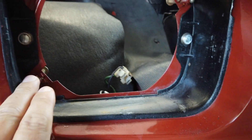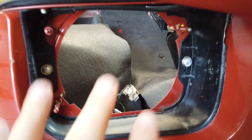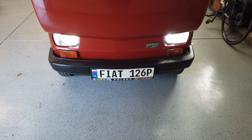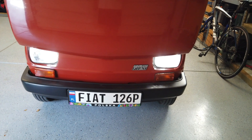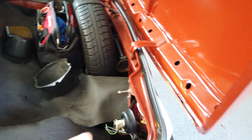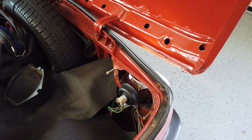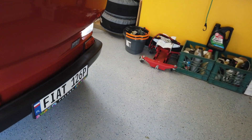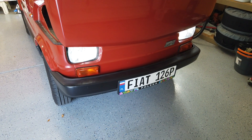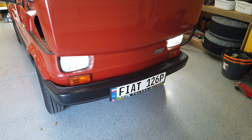There are just three posts — you can of course adjust the lights with the screws on the back, but mine are fine so I'm not going to mess with it. Now press the new one in. Here are both of the lights — extremely bright, night and day difference. If the parking LED is not working correctly, you may have to swap out the polarity of the connectors, because LEDs do have a plus and minus as opposed to a regular incandescent bulb, so just keep that in mind.